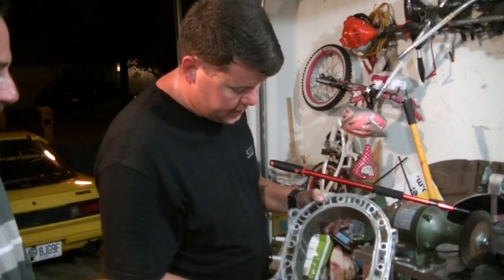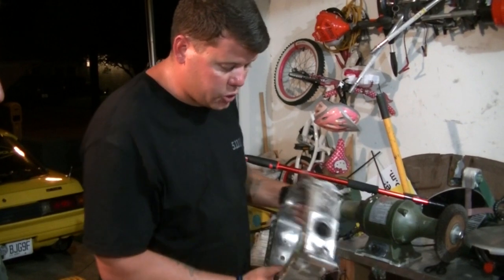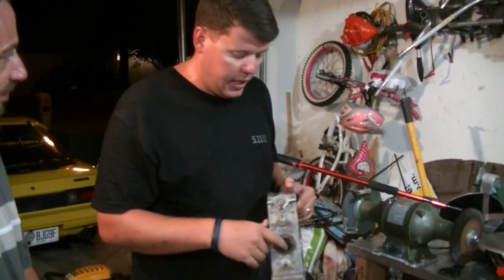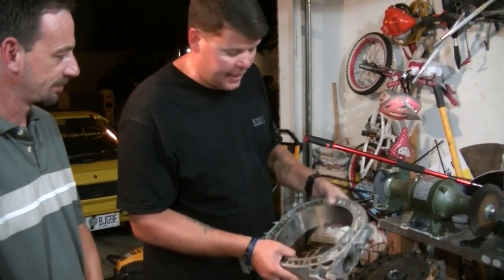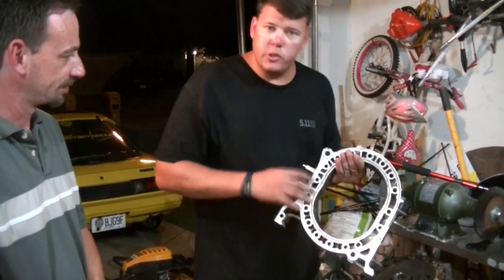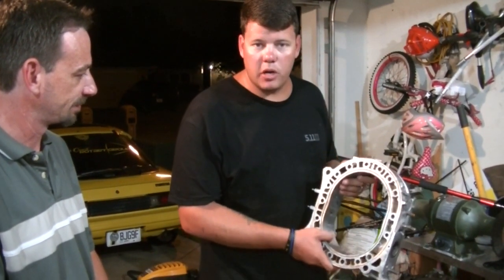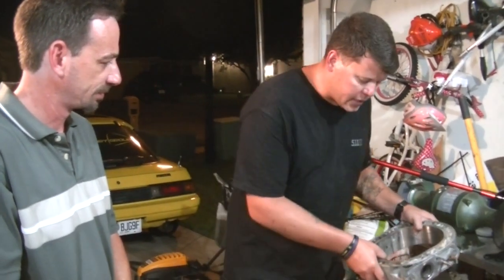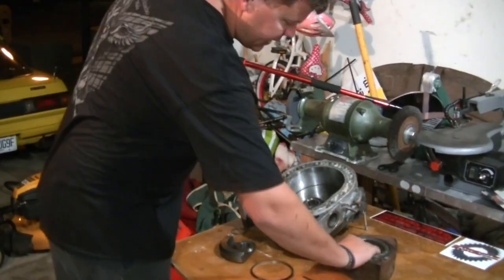All right, so simply what I'm going to do is take the rotor housing and attach it to the front iron. As you will notice, there is a peripheral exhaust port. This variation has changed recently with Mazda in what's known as the Mazda RX-8 and the 13B Renesis motor. Like I said, I'll come back to that and get you more involved in it. You will notice that there are two spark plugs per rotor. Same concept as two spark plugs per piston. One is a primary burn and one is a secondary burn. The characteristics of the motor are very different than that of your piston engine in multiple ways, but if I simply connect these two together for demonstration purposes, I can in turn take the rotor.